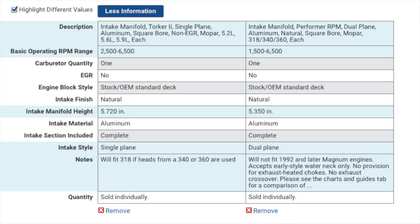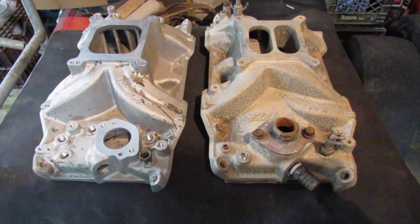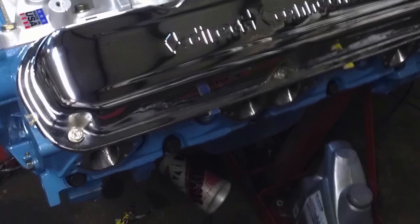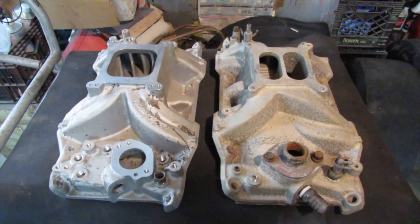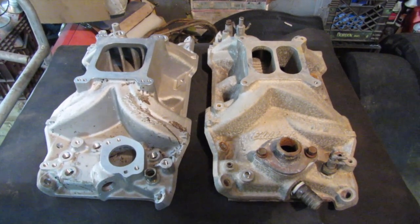This intake is rated 2,500 to 6,500 RPM, and looking at my camshaft — I've got a cam from Isky — I'll be spending most of my time above 4,000 RPM, so that will be an excellent bracket racing cam. That's what Isky recommended for me. I called them, told them my combination and all that is going into the 408 motor that's in my black truck right now. That truck is donating that engine for the Barracuda build, and I've got some different pistons to swap in. It's currently around 10-to-1 compression and I'll be right at 12-to-1 with my heads and new pistons.